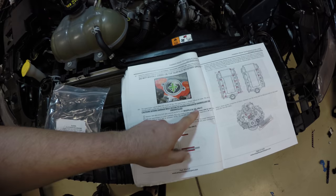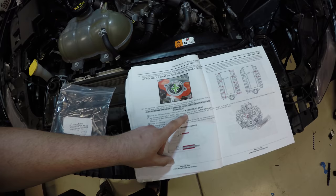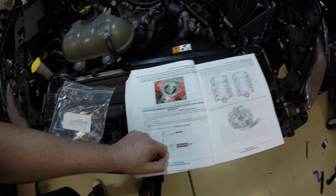We're gonna need a quarter inch Allen wrench. We're gonna put the supercharger on a flat surface, fill to the middle of the sight glass. We're gonna tip it from side to side and then check again. It takes a maximum of 8 fluid ounces and a minimum of 7 fluid ounces. We're gonna put the plug back in, and that's about it. Change every 100,000 miles.